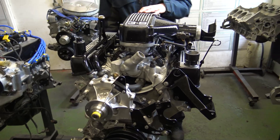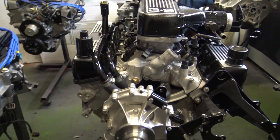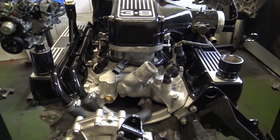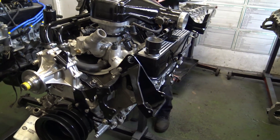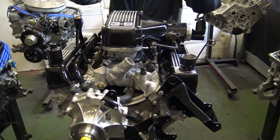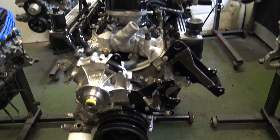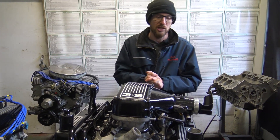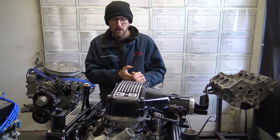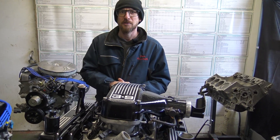This engine here has been built up for a Range Rover Classic — to replace the 3.9 we've built a 4 litre bottom end, so it's still 3.9 in capacity. It's actually an identical engine to the P5 one: standard cylinder heads, Piper TorqueMax camshaft. This time it includes the fuel injection system from the Range Rover Classic. The garage that extracted the engine sent us the exchange unit, all the covers — which Holly's already fitted — and the injection system. We're just waiting for the distributor to check over the mechanical and vacuum advance air gap on the pickup, so Holly can fit it and it'll be timed up ready to turn the key. It's going out with the ECU chip option as well — should make a classic Range Rover what it once was, but now RPI-fied.